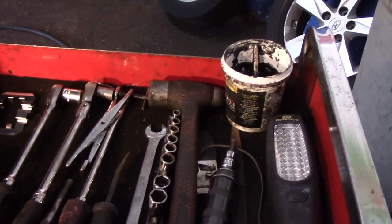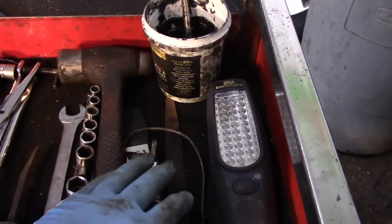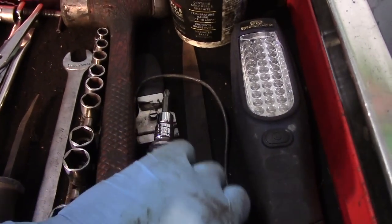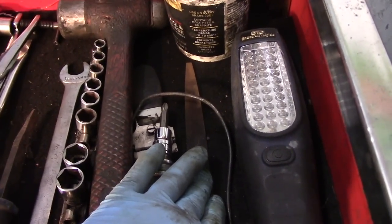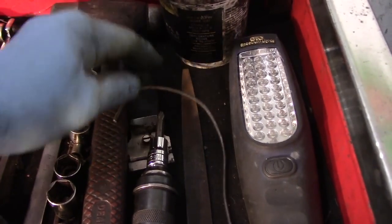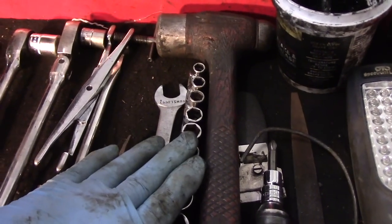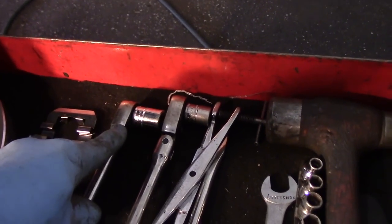Okay, this is an example of what kind of tools you're going to need. You're going to need a light so you can see what you're doing. You're going to need a driver to remove the screws that hold the rotor to the hub itself. You're going to need something like a file or sandpaper to clean up the mounting bracket as well as the hub assembly. Something to support the caliper while it's hanging so you're not hanging it by the brake hose. A hammer. An assortment of sockets — the ones I'm using are a 14mm and a 17mm.